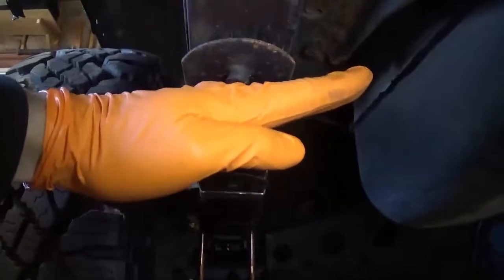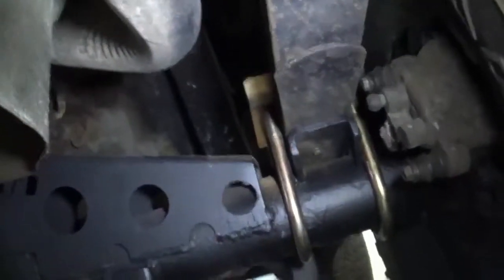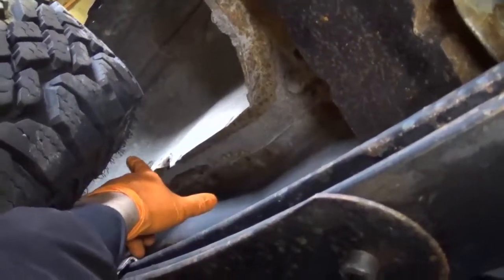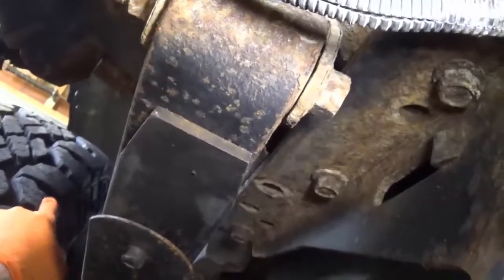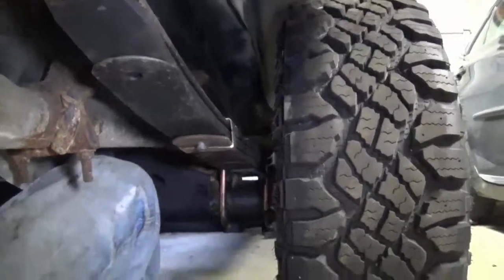That wasn't right. When you look back from the leaf spring, you could see the leaf spring was like this — that wasn't correct either. Same on this side: this leaf spring on the passenger side would have been like this, so they were bowed in. As well as the driver side tire, when I had it on like this, was too far out from the body compared to the passenger side tire on the body. I did a quick measurement between this inside frame rail to the outside of the tire, and when it was screwed up, this side was a full inch that way compared to the passenger side, which was a full inch closer.